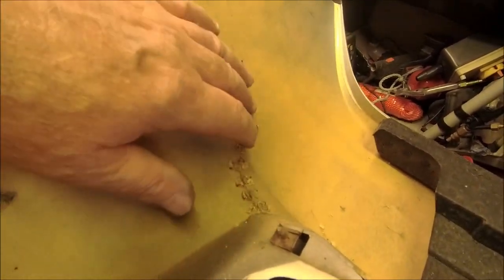It is a bit tricky on plastic because it's so thin. As you can see, we've got it all stitched together. You're going to get some heat penetration on the other side, as you can see. There's obviously a little gap there that's got to be sanded down and filled, but once that's done you won't even know it's there — and it's strong, that's the main thing. It can flex now and the strength is there.